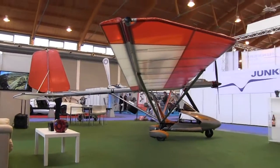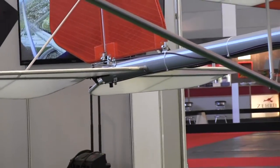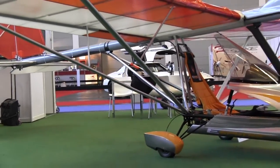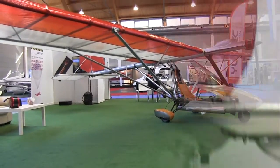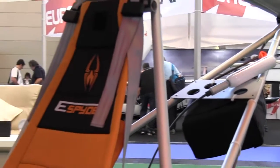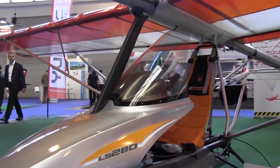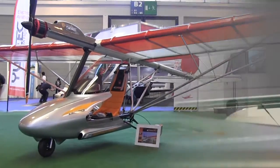This motor system has several things involved with it that are really smart. If you're starting to overheat the motor, the controller, or the battery, it'll start dialing back the power to keep you from doing that. It also goes through a self-diagnostic setup when you start it — you hear some tones as it checks the batteries, the motor, and the controller. Before you're allowed to add power to it — and we have to have new terms, since they're not horses and not engines, so it's not really a throttle — the propeller jumps back and forth to give you a warning.